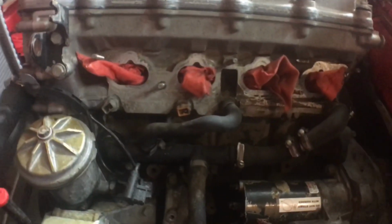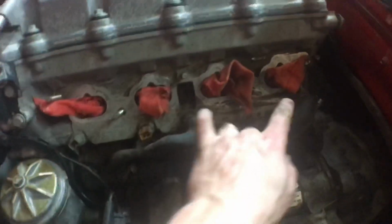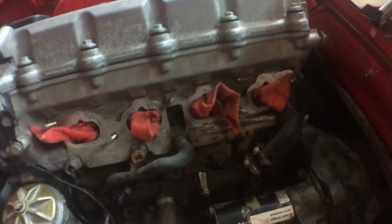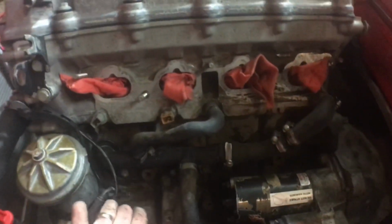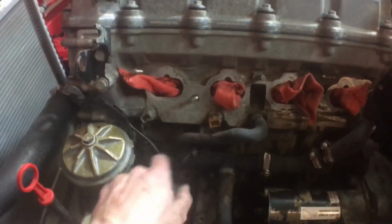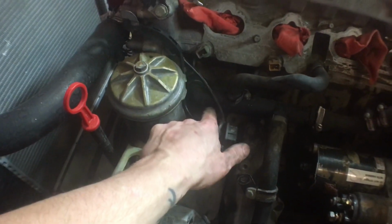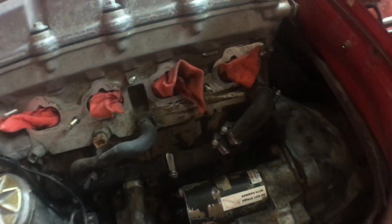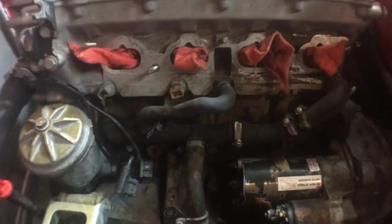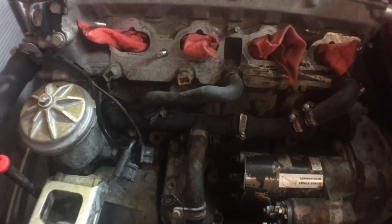So this is what's left of the plumbing. I basically was able to tie this port into this pipe here, this part into here, and I believe these are just the recirculation lines that will run down into the expansion tank. If they made a block off plate for this, or if I felt like taking that apart to find a way to make a block off plate, I could have eliminated this whole pipe and capped this opening and just ran this down to the expansion tank. But for now, this reused everything other than the one little coupler I had to make, and it'll work.